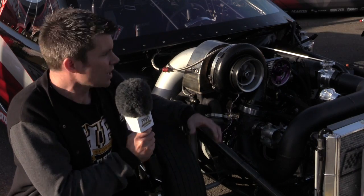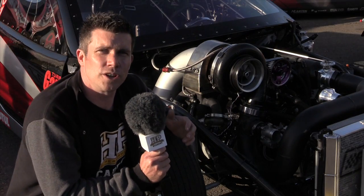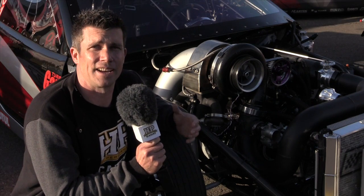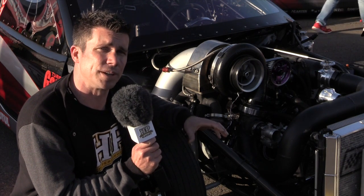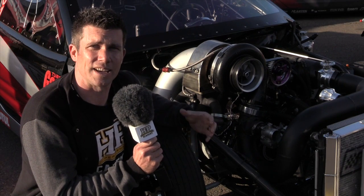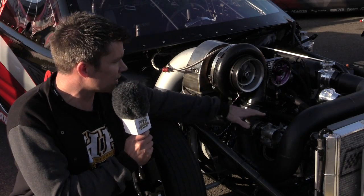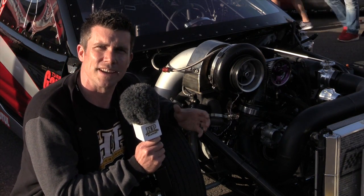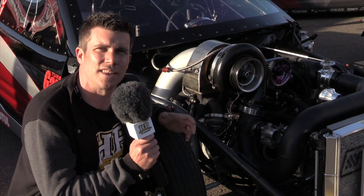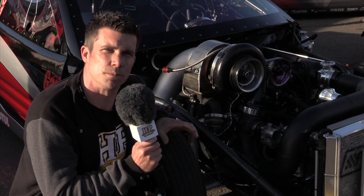The last thing is a little bit more subtle. With these small capacity engines, obviously we've got a massive turbocharger. When you're running the car and everything's working fine, that'll work well. But if for some reason the car gets loose and Colin has to pedal the car or short shift, that can drop things lower in the rev range. At that point we've still got a huge amount of boost pressure that the turbo's producing, and that can actually run the turbocharger into surge — where the compressor is pumping more air than the engine can consume, which is quite destructive. In that instance, the drive-by-wire throttle motor can be opened to relieve the excess boost, allowing that turbocharger to breathe and move that air, getting the engine and compressor out of the surge area. They're also using the turbo speed sensor you can see there to log and monitor when the turbocharger is actually moving into surge.